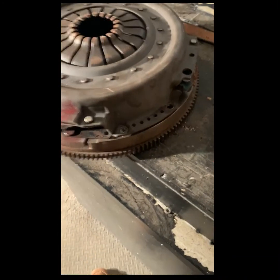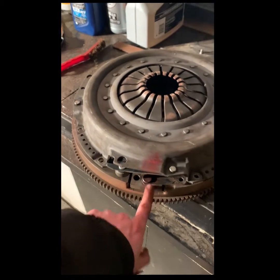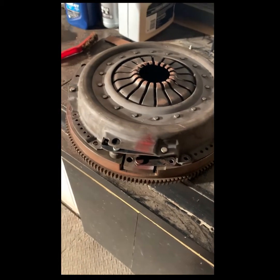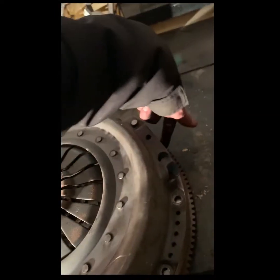I just kind of set it all back up, see. Fortunately, somebody thought of me and marked this as the indicator of up, to make sure that it matches up with the actual flywheel, if there's any paint left. Oh, yep, so over there. So that is my up right there. And then throw this bearing on here. Do rear main. I think I'm going to do the front main while I'm doing the balancer. It's still my car.